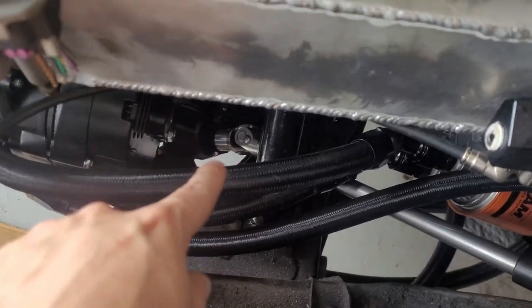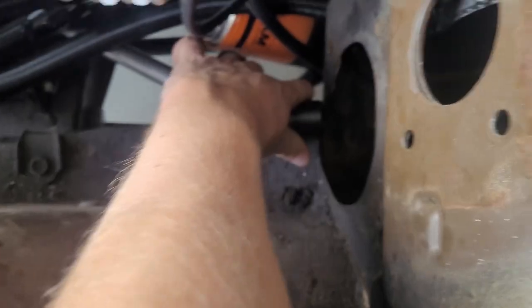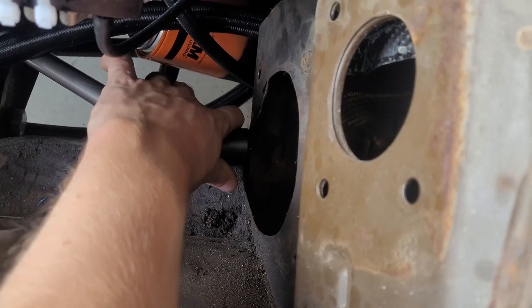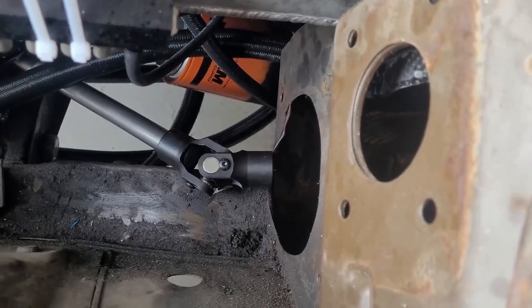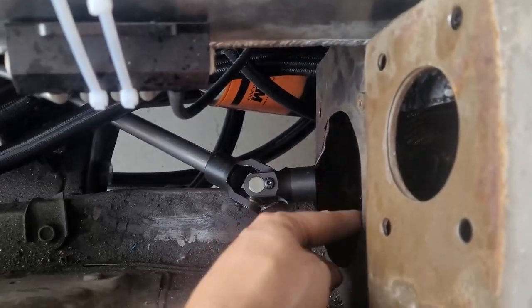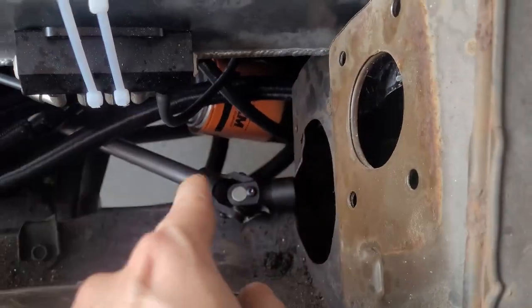Alright, so we played with the links a little bit. We got our main on-rack U-joint, a straight piece, and the second U-joint. When it's fully seated it's just about to touch the firewall. I still need to make a fill piece that mounts one of the heim joints, which I can then use essentially as a pillow block bearing on the firewall. That'll add some depth, and we still need to pound it fully onto the rack, which adds maybe that much. So it should be good length for this piece.